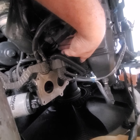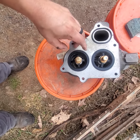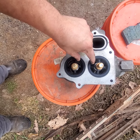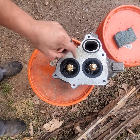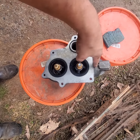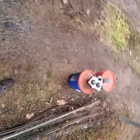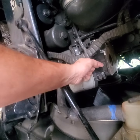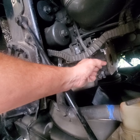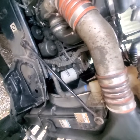Once you get that out, over here on your housing you got an o-ring and your two thermostats. The old thermostats were both 82°C if I recall correctly. The new ones — I think this is 81°C and this is 91°C. I put the 91°C closer to your radiator hose. To get it free from the block when it's sitting unbolted, take a hammer and just gently tap right here and it'll knock everything loose — get it swapped out, get it done.